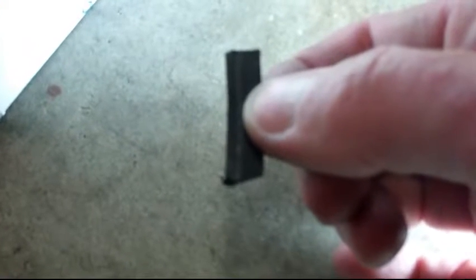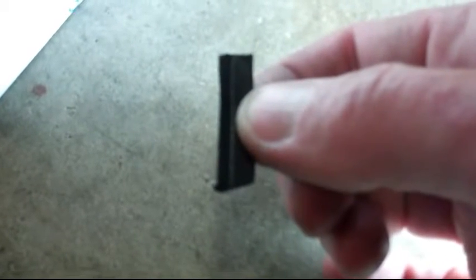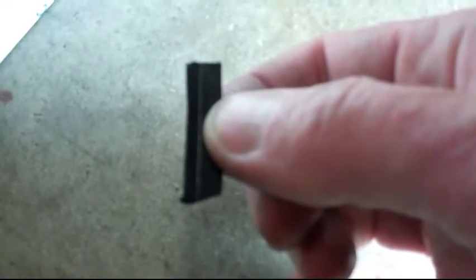The piece I was talking about trimming — this is how much I cut off so it could sit flush against your stock splash guard, just for reference. If you find any not-great fitting at the top, that's what you can do. The clip would force this in, but it would also just put pressure on the splash shield and move it out of its natural place. So it makes sense to shave off a little of that indent at the top so it can sit tighter and the clip requires a little less force.